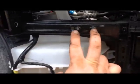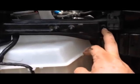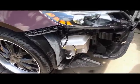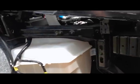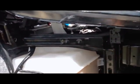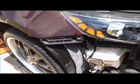These little suckers here are the 2 studs that have nuts on them, and this little hole is the bolt that I was telling you about that's on the inside that you have to remove to get the bumper off. Now, personally, I think it's a little bit redundant. You've got 2 nuts here and a bolt right here. So I am not in any way endorsing this for anybody else, but when I put my bumper back on, just like I did last time, I don't put this bolt in. I put these 2 nuts on and I call it a day. It's just too much of a pain in the ass. I don't fool with it. Again, I don't endorse anybody else doing that.